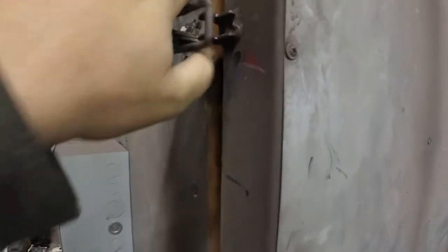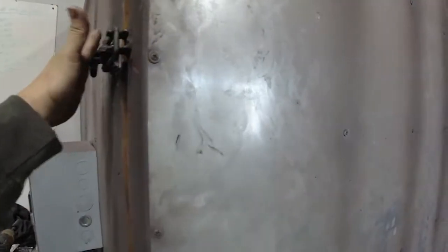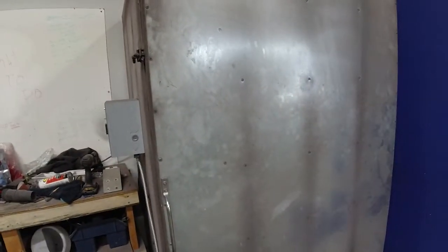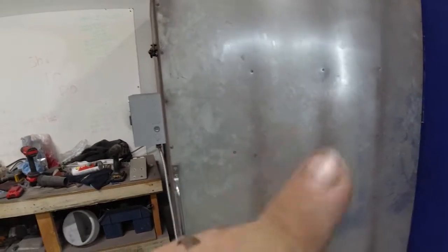Alright, so we just got it put in the oven. Let me check it out real quick. It goes in green, still in powder form. Once it gets hot enough, it'll all start to melt down. They call that flowing out. Once it starts flowing out, we'll set a timer for 2 minutes, and then pull it after that 2 minutes, let it cool all the way, and then we'll clear it, and then it'll go back in the oven.